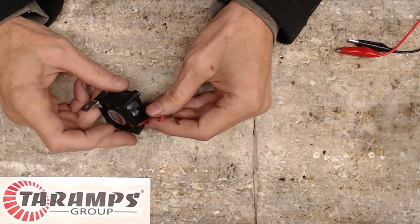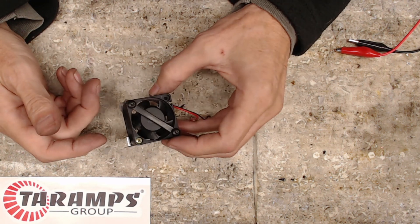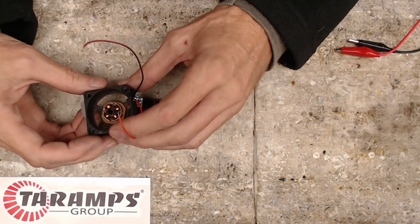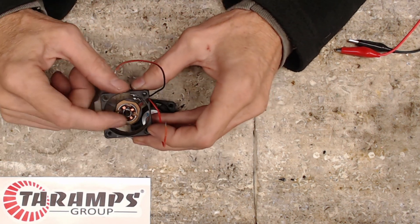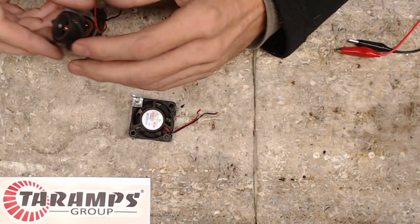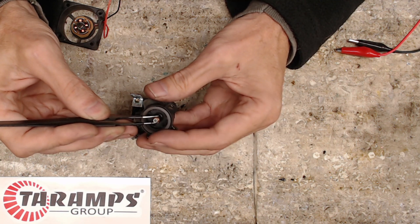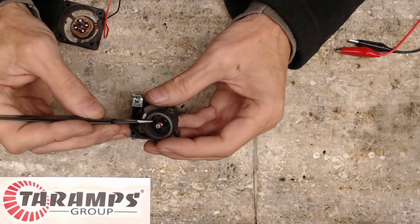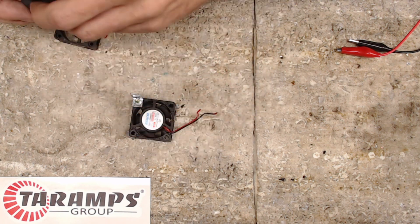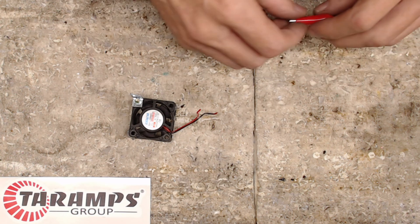What I do is restore these fans. As long as the stator itself is still functional — the board in here — these fans can go on and on until you literally wear out the shaft far enough to where there's too much play between the bushing and the shaft. But nine times out of ten they usually gum up and seize before they wear out.